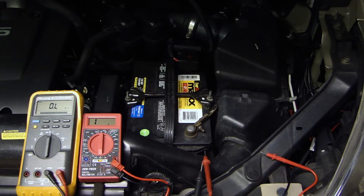Also, if you are installing an aftermarket amplifier which requires a lot of current draw, you need to make sure the grounding point for the amplifier is solidly good, otherwise you're going to have what they call a grounding loop.